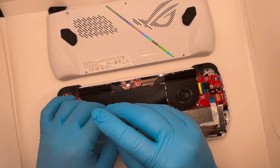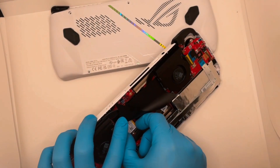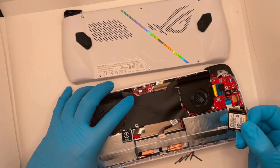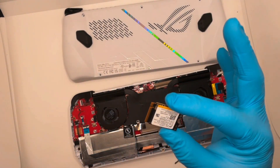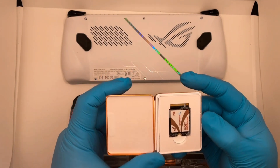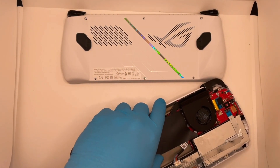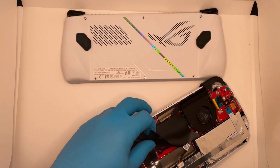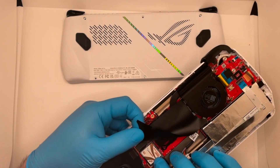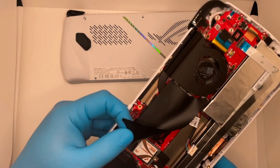Just unscrew this, save the screw, and just give it a little wiggle. There's our factory unit — that'll hold like two games. So here we go, here's our two terabyte drive. You just need to peel this back a little bit, then insert the new two terabyte hard drive into this little slot. Same thing, it'll just click right in — so we're guiding in just like that. Click, click, click — she's in. Shazam, it's in.